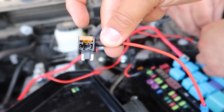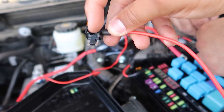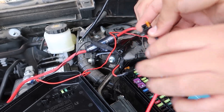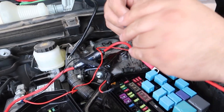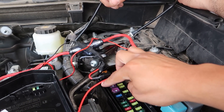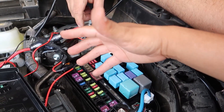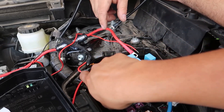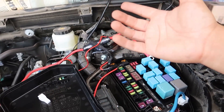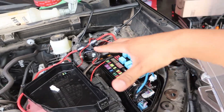The next step is getting our added fuse — we're going to put a size 5 right here at the top and then that 7.5 that we took off the fuse box we're going to be putting right here at the bottom. Once we do that then we can reinstall it and start with the wiring process. Now that we have the added fuse reinstalled, you're going to notice it's going to catch right here so we won't be able to close the fuse box. Like we did in our last video on the Raptor Light install, we're going to grab the Dremel and slightly cut a little bit on this side and slightly cut there so that way the fuse box can close once again.